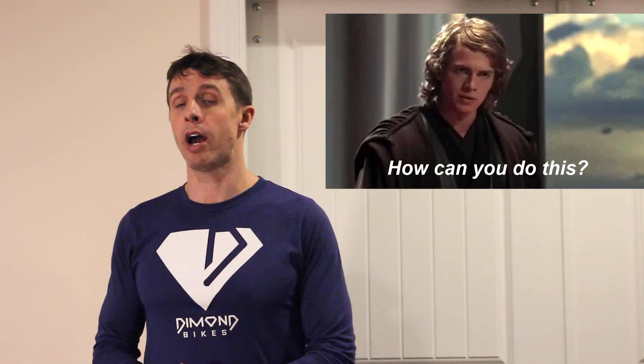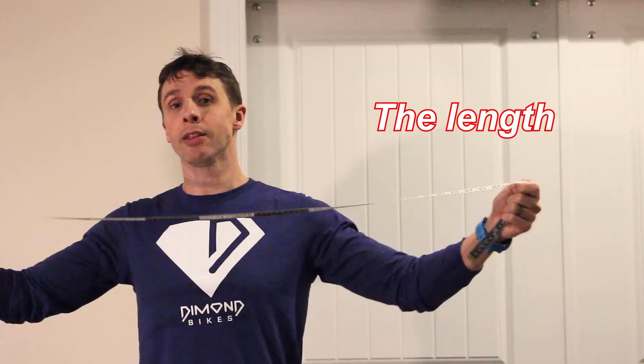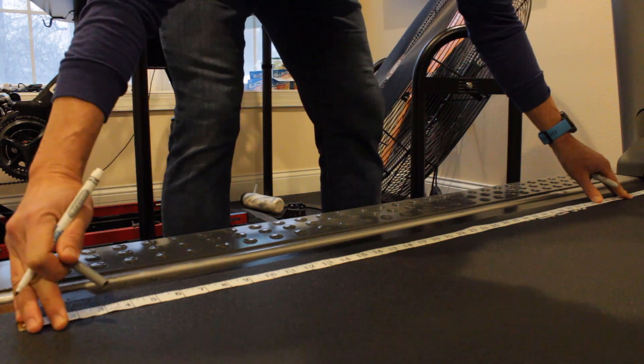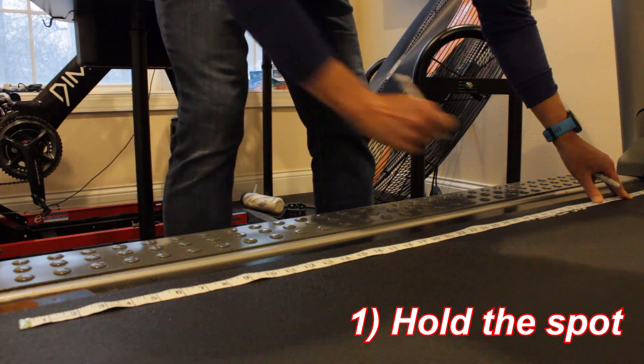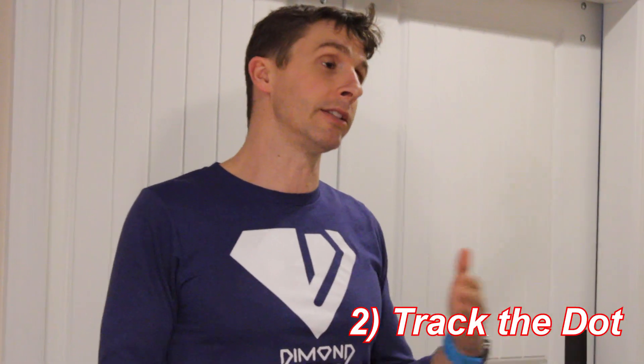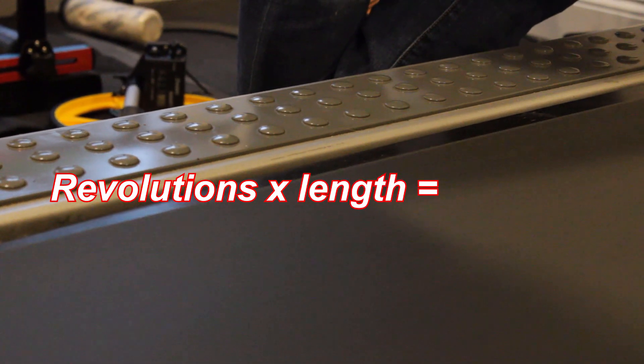The other way to do this if you don't have a measuring wheel: take a standard measuring tape and measure the length of the treadmill belt. I have these markers so I can hold the spot of the measuring tape — because the belt is longer than the 60 inches I have here — and also so I can track a colored dot and see how many times it goes around. For any given distance I can do a simple math equation: count how many revolutions the belt makes, times the length of the belt, and that gives me the distance it travels. Compare that to the distance the treadmill said it traveled, and you will see how accurate your treadmill actually is.